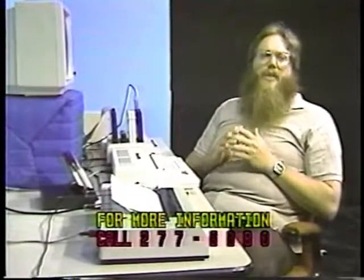By now, you might be wondering what would happen in the event that you used a PRINT#-2 command without data to be sent to the printer. Well, in the actual result, you get something different in different situations. If you had a comma following the PRINT#-2 command, you would get one of those aggravating syntax errors that you see from time to time. This is because it was expecting to find data to send and found none.